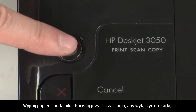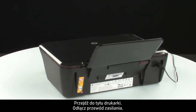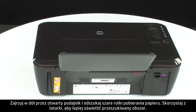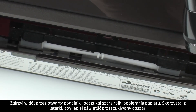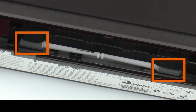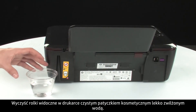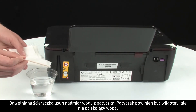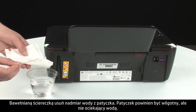Press the power button to turn off the printer. Turn to the back of the printer and disconnect the power cord. Look down through the open input tray and find the gray paper pick rollers. Use a flashlight to illuminate the area. Clean the rollers visible in the printer with a clean cotton swab, lightly moistened with water. Remove excess water from the swab by blotting it on a cloth. The swab should be damp, but not soaking wet.